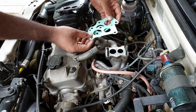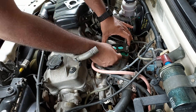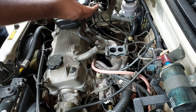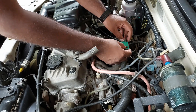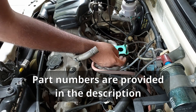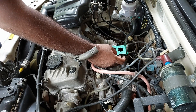We need two gaskets here. There is no need for gasket sealer or anything. If possible, use only MGP gaskets. Likewise for the insulator, use only MGP. A few aftermarket ones are available but they have been problematic for the most part - in some cases they have melted.